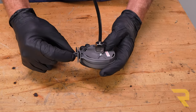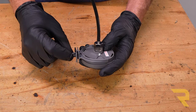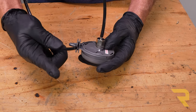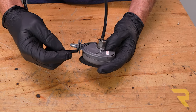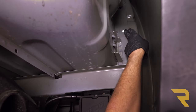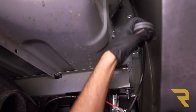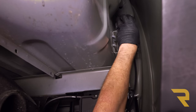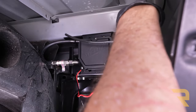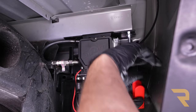This part is designed to snap into a hole. If you don't have a factory hole that's suitable, drill a three-eighths hole. We've got a factory hole that works, so we're snapping in at a high location, then plugging that end into the barbed fitting on the compressor. Right up here is a factory hole we can use for our filter housing, so I'm going to wrap my hose down, grab the tubing cutter, and plug that in.